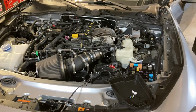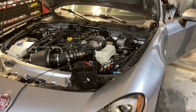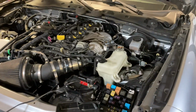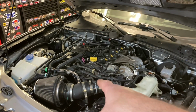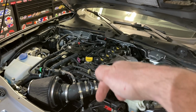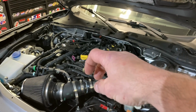So again, it worked. That's why I wanted to get this out there, because I've been looking for about 4 days now, on different forums, trying all these crazy things. This worked like a charm. So again, you're basically pulling that fuse, opening the cap, getting yourself that pick, sticking it on the little ball bearing, pushing it down, and getting something large enough that it doesn't fall in the engine to weigh it down.